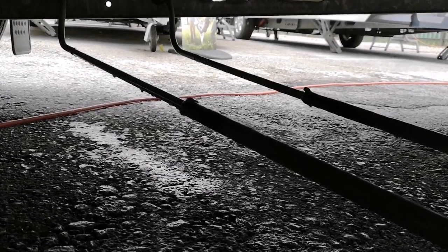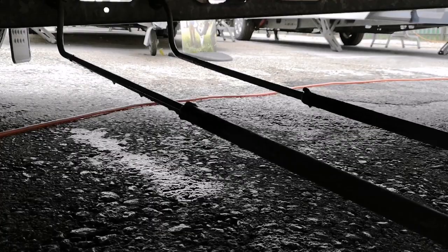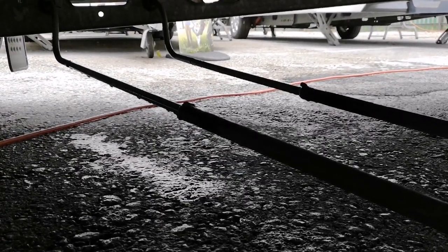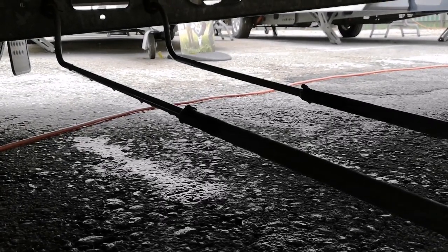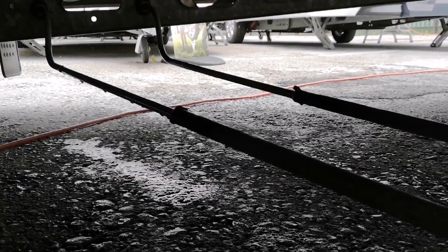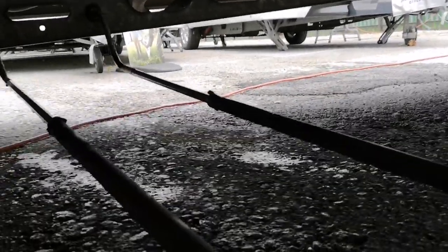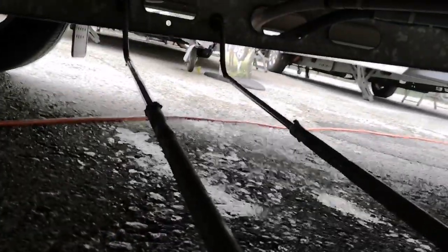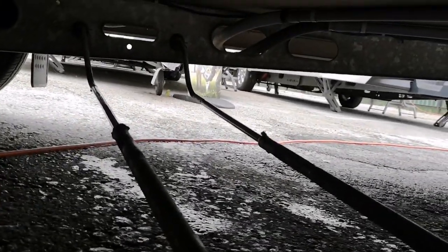You can use a little bit of grease on a brush if you're not in an area where you can let the WD-40 go onto the ground, but we'll clean the ground up afterwards so it's not a big issue. We've lubricated the runners and now we're going to push the carrier in and out just to make sure it's moving as free as possible.